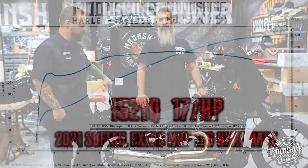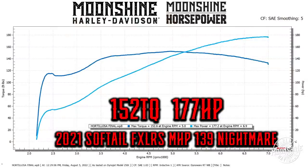We're going to show you this dyno graph again. See all this stuff down here below 3,500, below 4,000 RPMs? That is sacrificed because the combination of the larger exhaust takes RPMs to build pressure, and the cam in combination with it are both designed to really eat together from 3,500 to 4,000 and beyond.